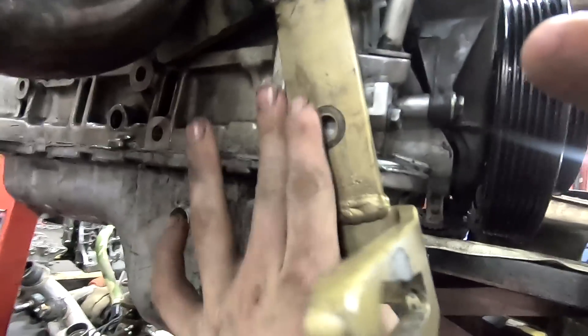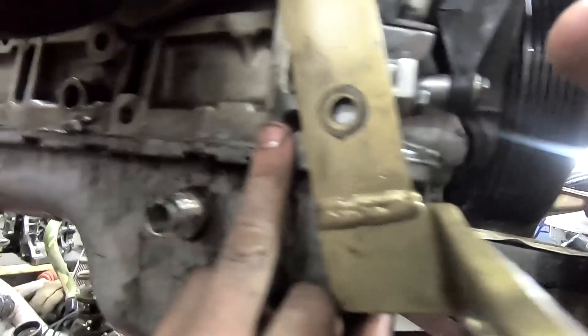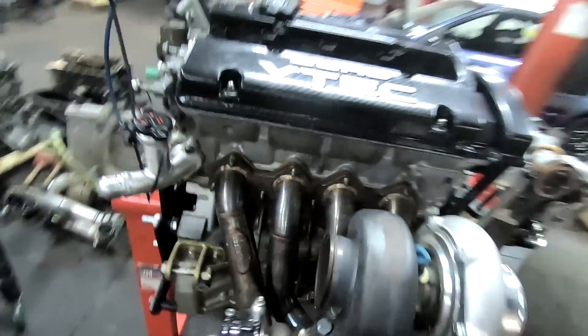So we're gonna go ahead and just lop this one off, build a new bracket - well, same bracket but we're gonna make this smooth. We're gonna weld over on this edge here, make it straight how it's supposed to be, these bolt holes lined up top and bottom - just do a straight cut right there, boom, simple, nice and tight. Everything's there with the distributor but the distributor's not on because it broke an ear off. I could put new ears on it - that's easy stuff - and then get him back on the track.